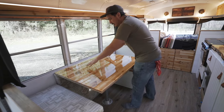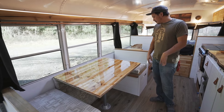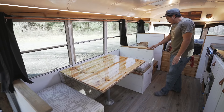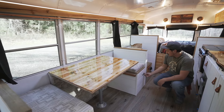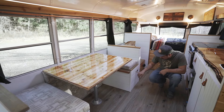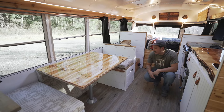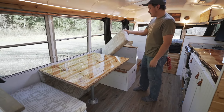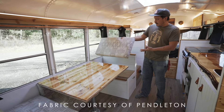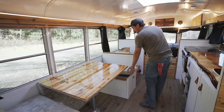This is three-quarter ply with cedar, epoxied for a really nice tabletop. Everything in here is built out of two-by-three plywood and shiplap — a two-by-three frame that's shiplapped with trim wood on top. Over here you have 12-volt DC on and off to charge your phones and camera batteries, and a battery monitor here because I put the charge controller under the bed — you can just check right here and see the battery is at 100%. The cushions were professionally covered by Hannah Babbs — she did an amazing job. Pendleton gifted us this fabric for the cushions and it looks amazing.